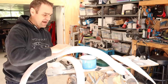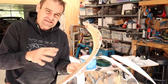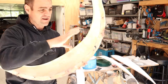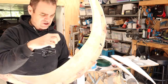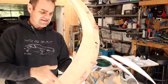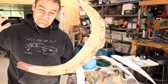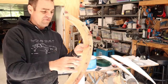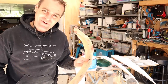I've gone through and put fiberglass filler on all of the edges, all the little bits where they were missing stuff. Any of the captive nuts that weren't completely covered in fiberglass before — the main ones that were spinning were the ones I hadn't completely encapsulated in fiberglass originally — so this fiber reinforced filler is filling in all those spots. I've got my little dowel pins through all of them as well. Now I need to go through, grind off the little tips of the pins that are coming out, and then start sanding fiberglass — my favorite.